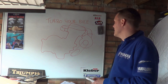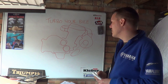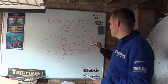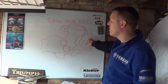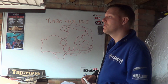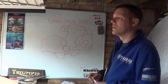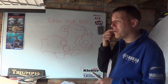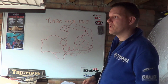The next thing you have to consider is your oil supply. Obviously your sump is down here and your pump is generally somewhere around here in your engine. You have to be able to pump oil to your turbo housing and then return it. The return line isn't the most difficult thing — that's the easy bit. It's where to pick on your engine a bleed-off for your actual turbo itself. A lot of people I've seen are pulling off their main gallery — you have to be very careful doing that. We'll go into how to work out all that in a later video. If the pump has been optimised just to creep above the pressure of the engine and you go and pull off quite a lot of oil off your main gallery, then your crank bearings will probably suffer because the pump doesn't have enough mass flow rate. You might even have to upgrade your pump.